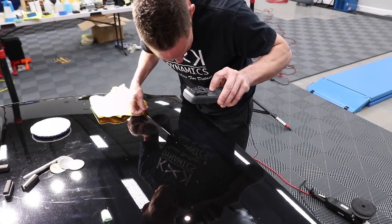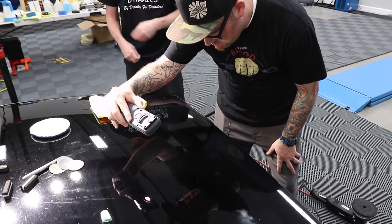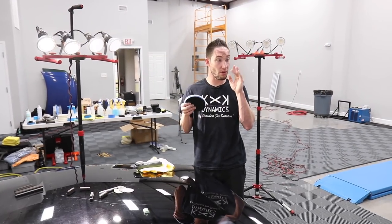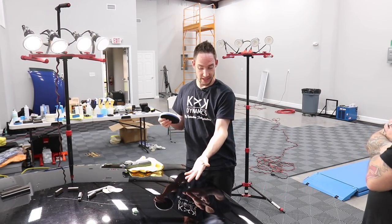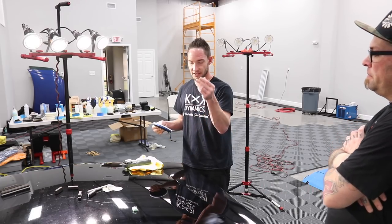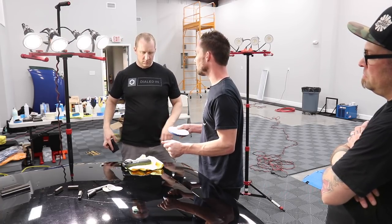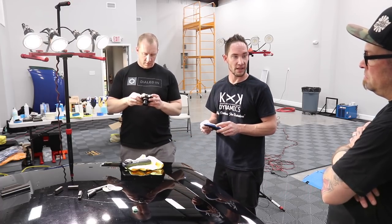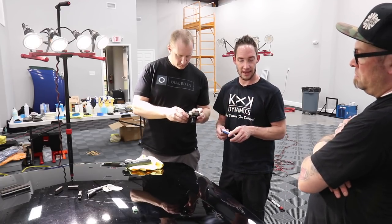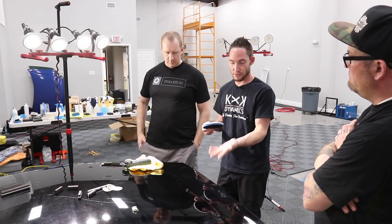And to my eye, that doesn't look good, but it doesn't look bad. It's added the gloss. Send it out the door. It's matte technology and a different abrasive set, and do the exact same thing. I actually use this like matte technology is supposed to be used. It's the idea of pressure, quick movement, letting the abrasives do what they need to do and then stop. I think the abrasive sets nowadays and the chemicals are so good and so refined that we don't need to over polish, because they do their thing and then they're done. So let them do their thing and be done.